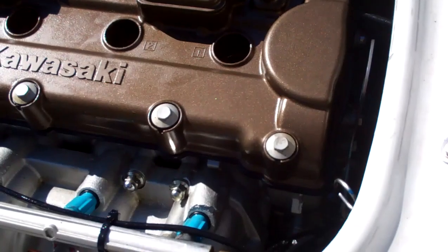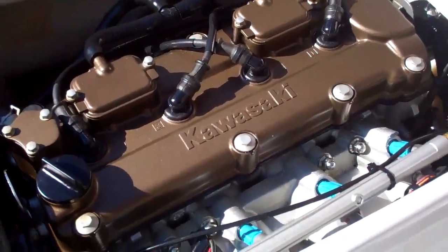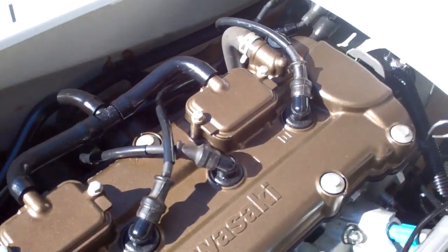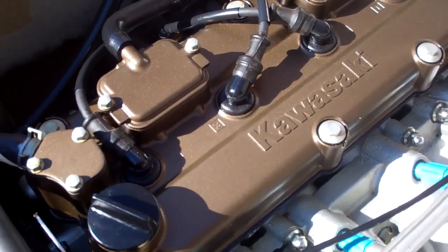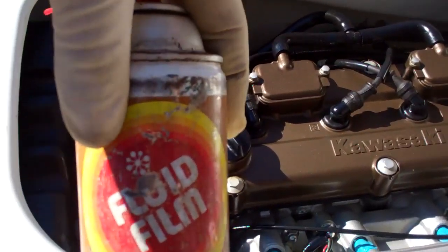The engine's fogged and that pretty much completes everything. The only last couple of things — I want to use fluid film. I'm going to spray down a light coat over all the metal on the engine. Make sure to get down on the muffler and in here on the metal because I saw a little place where I had some rust that wasn't coated. Don't do the actual muffler — I'm talking up in front of it. Just coat everything, give it a little spray. Go around and do all your cables — your throttle cable, your steering cable — everything that you can lubricate, go ahead and spray it down with something like fluid film, not WD-40, which is going to dissipate. Fluid film is kind of a coat. The fogging spray would probably work too, but I really like fluid film.